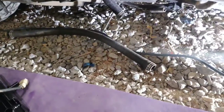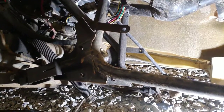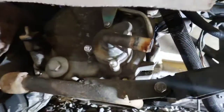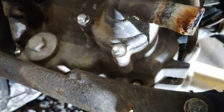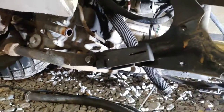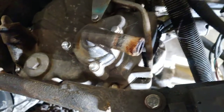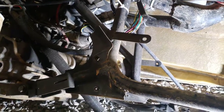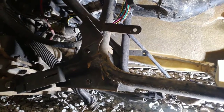You can see the radiator hose hanging down, and here's the other one. It's a tight fit, and it's all chopped up inside. I got so much stuff to clean out of this thing. There's the water pump — look how nasty that is. I gotta get a wire brush and clean all this. For the most part, the water that came out of it was pretty clean, but I don't think it's been taken apart since it was new in 2008 or 2010. I'm gonna go ahead and install it, clean that, reinstall the radiator, and show you what it looks like bolted in.